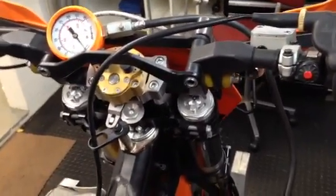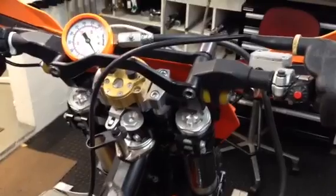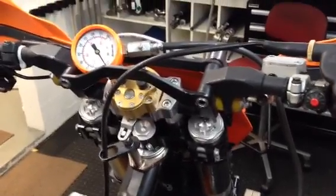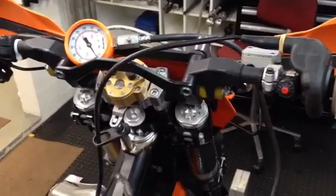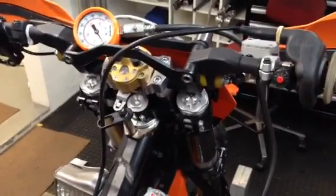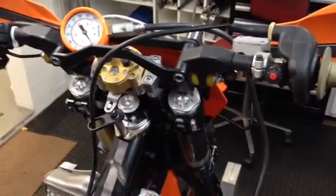On my bike, this bike cranks out 210 pounds — the starter struggles to get anywhere near that. So put a good boot on your right foot. Kicking with a tennis shoe or street shoe will definitely bruise the bottom of your foot, and you need to kick them hard. Get up on the bike with the bike on a stand, throttle wide open, hold the kill button down, and kick it like you hate it. Don't give it a weak kick or you'll get very poor results. Kick it until the gauge completely stops — it might be 20 kicks. Bring the kick lever all the way up to the top of the stroke each time to get a full swing, and kick it hard the entire time. That's all it takes.